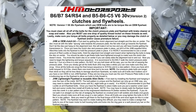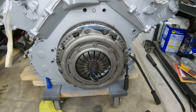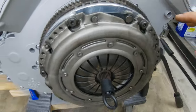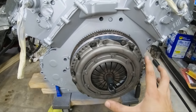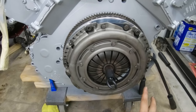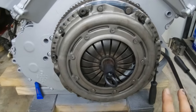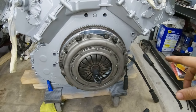According to JHM, the torque spec is 33 foot-pounds in a star pattern. Because there's a spring in the clutch, you can't just torque straight to 33 foot-pounds — the reading will be off. What you want to do is make sure all the bolts are flush against the flywheel first. For me that happened around 15 foot-pounds. So first I torqued all six bolts to about 9 foot-pounds, then went to 15 — that's when the spring was fully compressed against the flywheel. After confirming all six bolts were at 15 foot-pounds, I then torqued all six down to the final 33 foot-pounds.